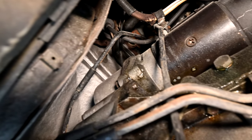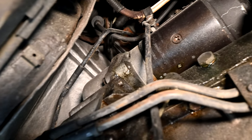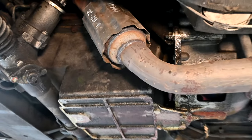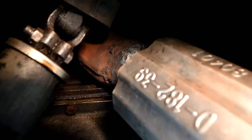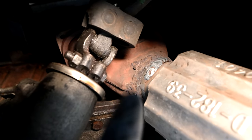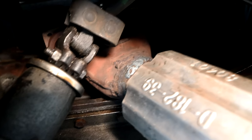I think I can see where our coolant leak is coming from — it's coming from up top. There's a rusty old clamp holding a coolant hose that seems to be leaking. Now, one common problem with these XJ6s is that they develop cracks in their exhaust pipes. This is on the driver's side, and as you can see, it looks like they've welded it — it probably cracked and they welded and repaired it. I do not hear an exhaust leak, so that's good.